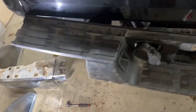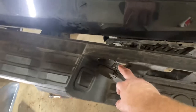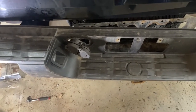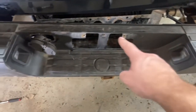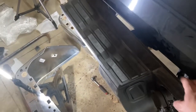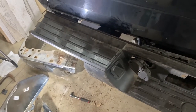In order to get these off, the last two bolts that were tucked up here were actually a huge pain without taking this plastic piece off. Similarly to how I did it on this side, I also did it on the other side, and then just popped this off all the way across. This was held in — you can see these spring clips right here — I actually just pulled them out. The last thing holding it on was actually a screw right in the center behind the license plate. So once I pulled off this side, I popped that side off. I had to take off the license plate and take the screw out to get this plastic piece off. But with this plastic piece out of the way, now I can get access to all the bolts easily.